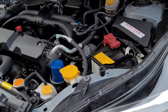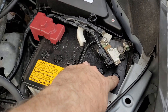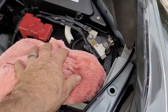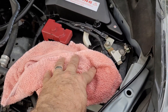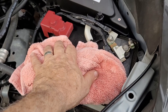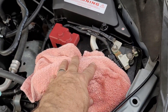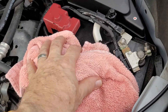The manual on the booster cable makes a point: check your battery if it has removable caps — make sure they're not loose or flat. Get a damp cloth and put it over the battery. If your battery is damaged and there's any smoke coming out, you want a damp cloth to absorb it, because that could ignite. I realize that many times in my life when jumping a car, I always put the jumper cables directly on the battery. I'm paying more attention to safety now, but that was not the way to do it.